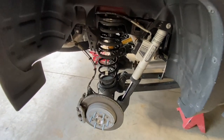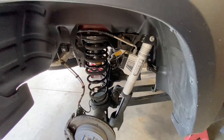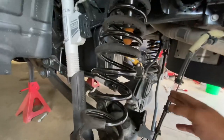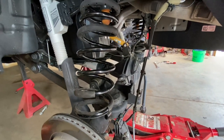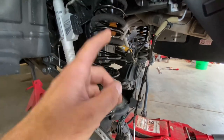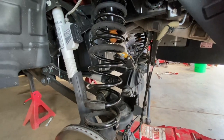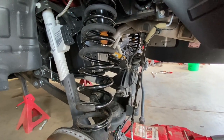To get the driver's side to drop low enough, I hooked the shock back up on the passenger side and then had to unbolt the track bar from the axle at the axle end to allow enough drop travel to get the spring out. I'm now in the midst of putting the spring back in. As I put that shock in on the other side, I made sure the coil spring notch was aligned at the top where it sits in its rest. We'll make sure we do the same on this side, then jack the axle back up and keep bolting things together.